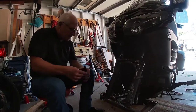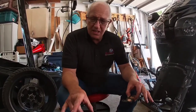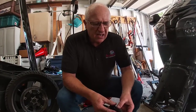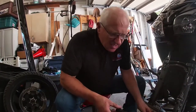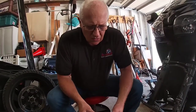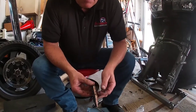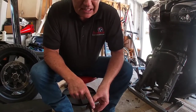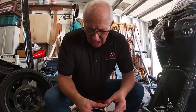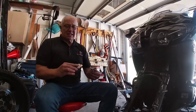So you can see here — here's his brake pads that came off. Notice one side doesn't have metal, the other does. There are your pads right here. So you can see the pad part here. Now let's look at the new set laid beside it. So let's do a comparison — see how thin this is? That's a new one. So like I told him, he's about half worn. He doesn't want to get back in here and do this again. They're not hard to do — I can do them with the wheel on. Anybody can. But it's easier when you get the wheel off.